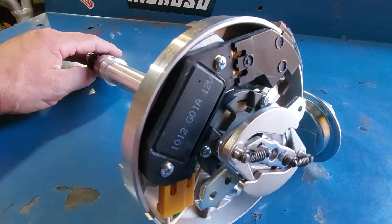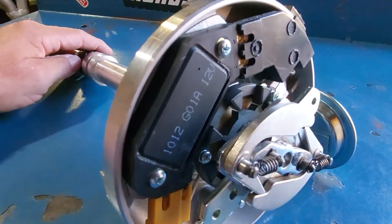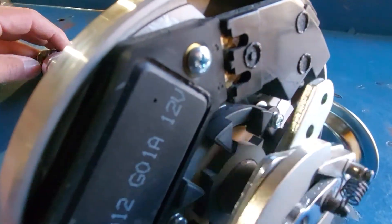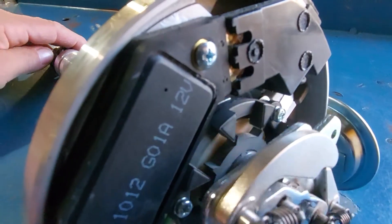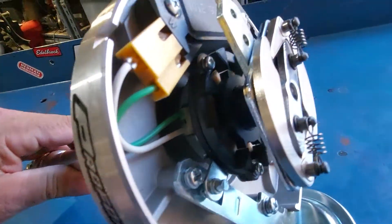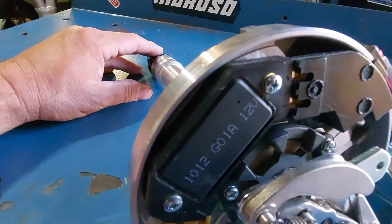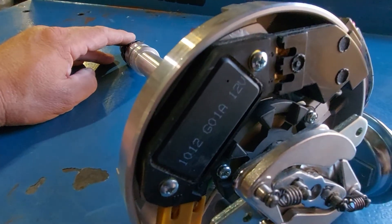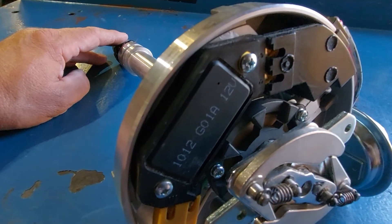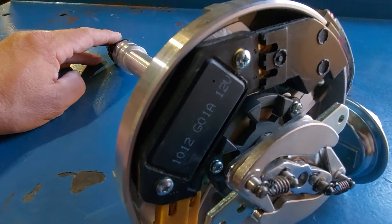Super quick on how they work: the purpose of the ignition control module is to convert the tiny little pulse that's created inside of the pickup coil. As these triangular reluctors get close to each other, they'll produce a magnetic pulse. That tiny little AC pulse is transferred through two wires to the ignition control module, which converts it into a ground. When you ground a coil and unground it, that's when it sparks the coil off — that's all these modules do: fire the coil to spark over and over again.